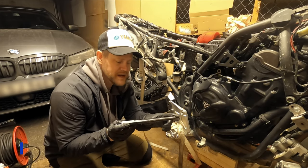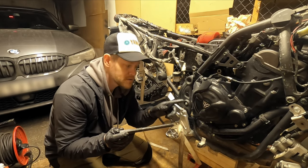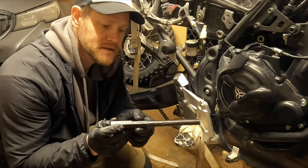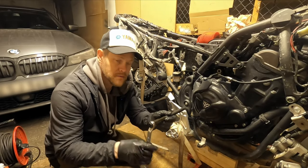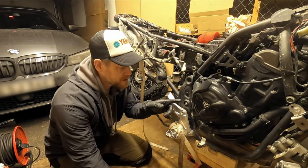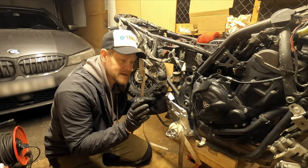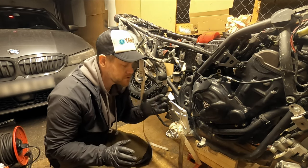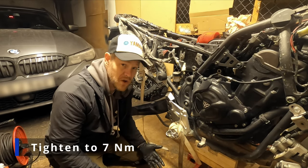This shaft here is the axle that holds the swingarm. In here you have the 15 millimeter hex key, and out here is just something to hold onto when loosening or tightening the push collar. The only thing the push collar does is push the swingarm to the left and keep it tight so it has no play — it cannot move left and right. I think it was about seven newton meters of torque that you apply on that one.